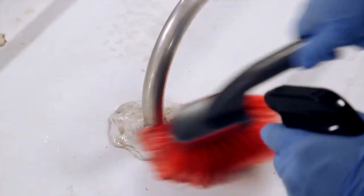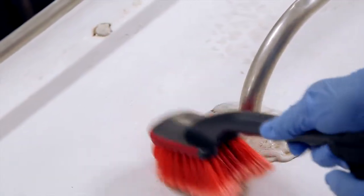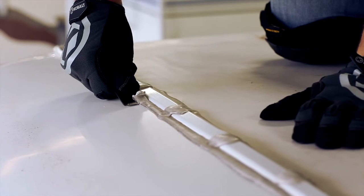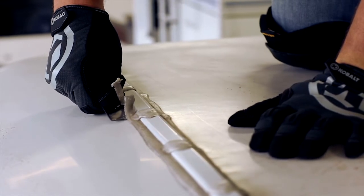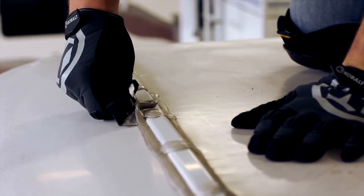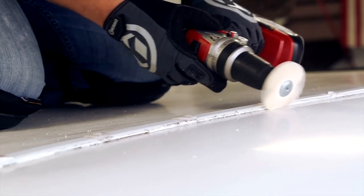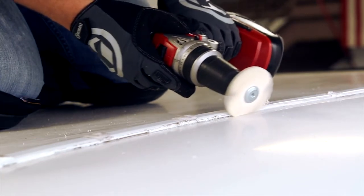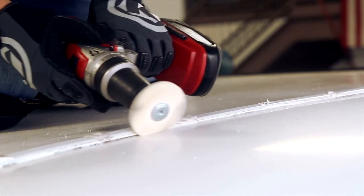Step one: thoroughly clean and evaluate the RV roof surface per your RV manufacturer's recommendations. Allow the roof surface to dry before removing the old sealant. Step two: completely remove all loose and existing sealant around the vents, skylights, antenna mounts, and trim. Start at the front and move toward the back. Carefully remove old sealant using a stiff putty knife — warming the putty knife first gives better results. For additional loose materials, use a handheld drill with a non-abrasive wheel attachment. Remove all old sealant down to the roof membrane, metal flanges, and plastic surfaces.